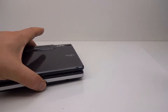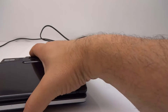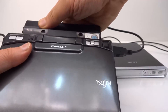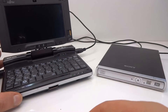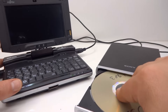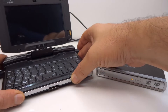To update the operating system I have a USB CD-ROM drive, or DVD burner in this case. We've got our power cable for the computer. We'll put the battery back on. OK, there's all our components set up and it should be as simple as that. So first of all I'm going to start with Windows 10 to see if it will actually install onto this computer. This is the latest version 1803, and it's the 32-bit version because this is a 32-bit CPU. So that spins up — let's boot up and do an install.